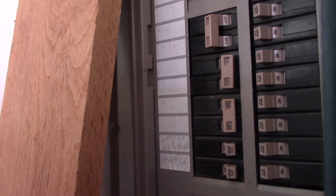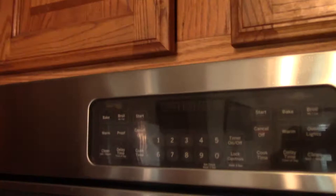We've just turned the power off at the circuit breaker, so the oven is dead — no power. We are now electrically safe from any shock risk. The next step: we've already taken the oven racks out and set them aside. For the sake of simplicity — it's not required, but helpful — we're going to remove the doors to make it a little bit easier to handle.